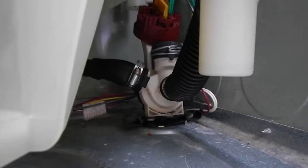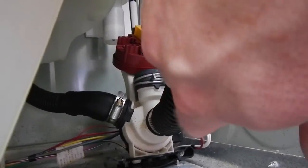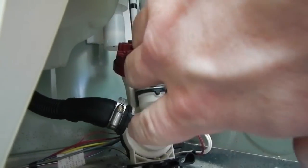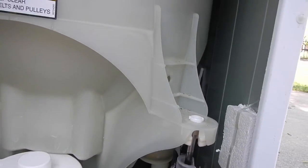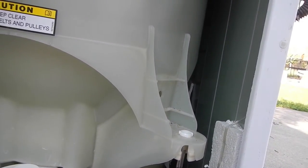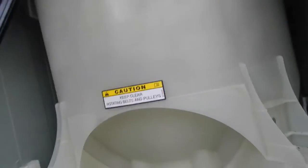If it is the water pump, it could be a couple of things. It could just be a bad pump or there could be something stuck in any of these hoses — there is a hose back there and a hose here. If you are going to replace your water pump, it is going to cost you about $120. I did that and it made no difference whatsoever — my clothes were still coming out wet. So it was not my water pump.